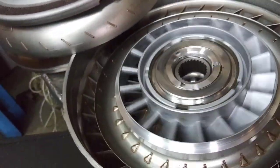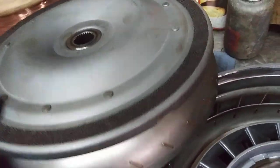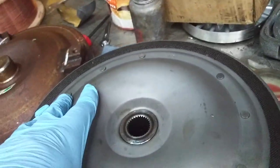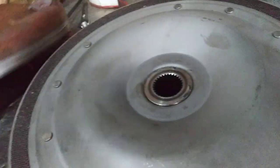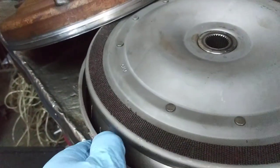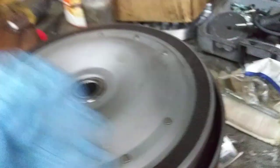When you put your vehicle in gear, basically what happens is this part right here — the turbine assembly — stays stationary while the torque converter itself is turning, because it's bolted to the end of it. These two pieces are welded together, so the converter itself is turning but this part stays still, so the bearings are working. Now as you take off, the two pieces start spinning together and the bearings don't have to work as much, if at all, and the whining will fade out.